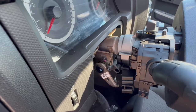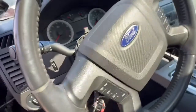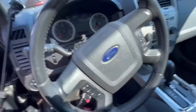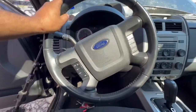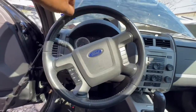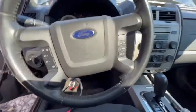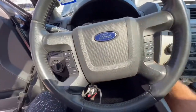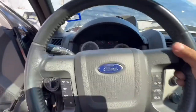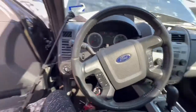We've got all the connectors out. Next step: the manual says to get the best alignment on the torque sensor, get the steering wheel to about 11 o'clock — like you'd see on a clock. Right now it's at 12, so we need to move it just a little bit. Okay, about like that — almost 11. You can see it's not perfectly straight. That's our next step.